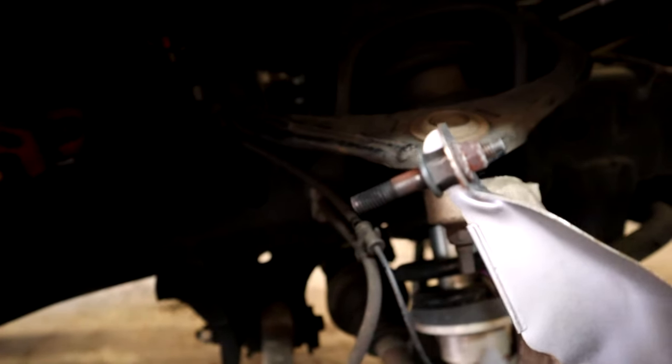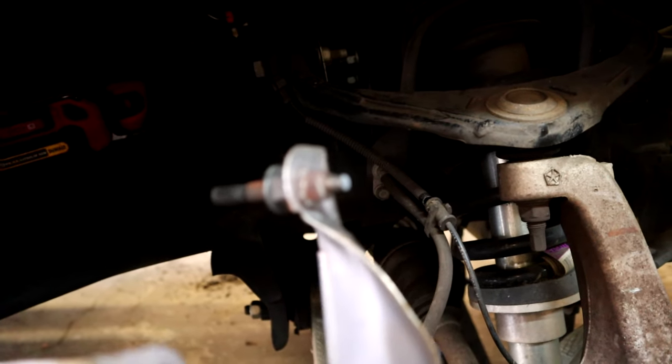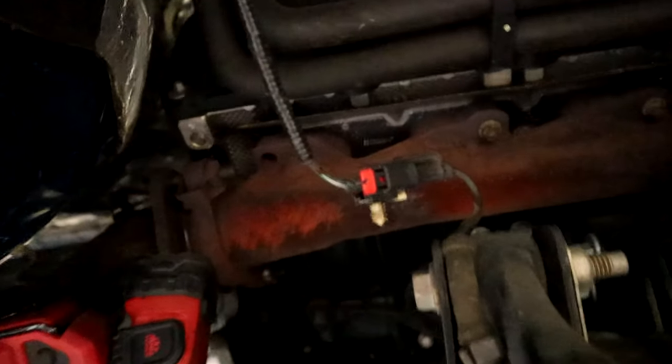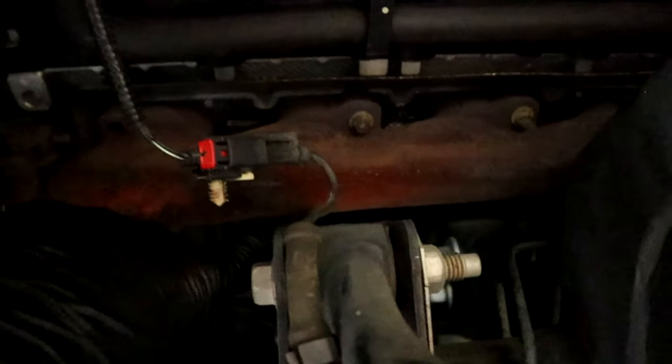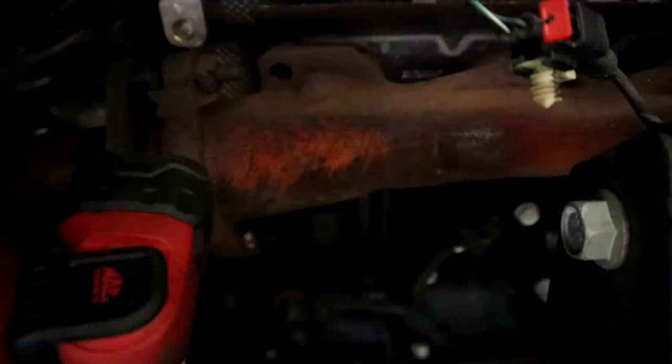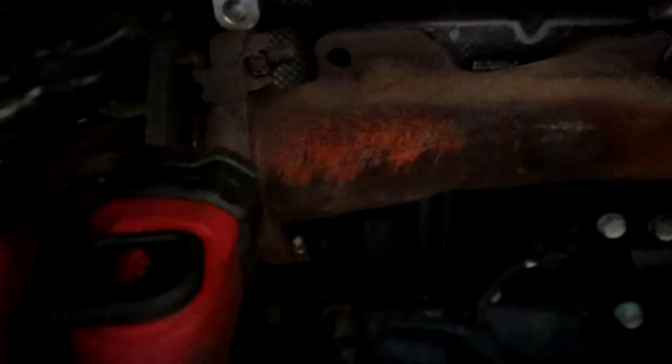And typically when the truck warms up, the ticking and knocking noise will go away, and that is usually a true sign of a broke exhaust manifold bolt like this one. And I'll show you on the manifold. Here's our stock exhaust manifold right here, and you can obviously see the back upper corner hole up here is missing a bolt. If you go over here next to it, you can see there's a bolt and then there's another bolt. So all the bolts are there except for that one is broke off.